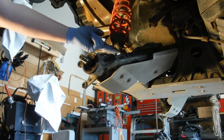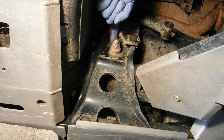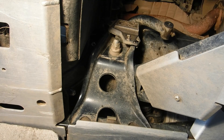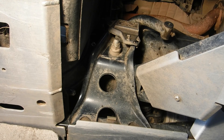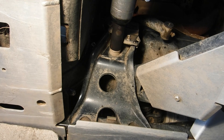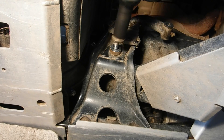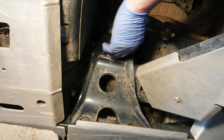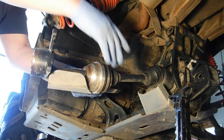I'm just going to tie the shock up to the rear rack so it's out of the way. This nut — I don't have metric that big so I'm using 15-16ths, pretty snug. I've got a 15-16th wrench on the other side. There are nuts on both sides — last time one loosened off. There we go: nut, spacer, swing arm, axle.